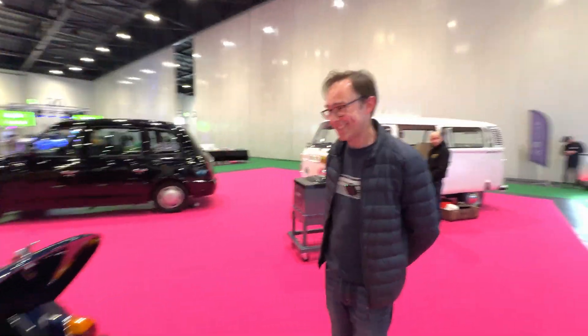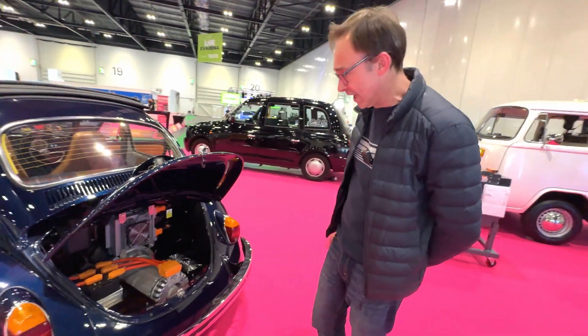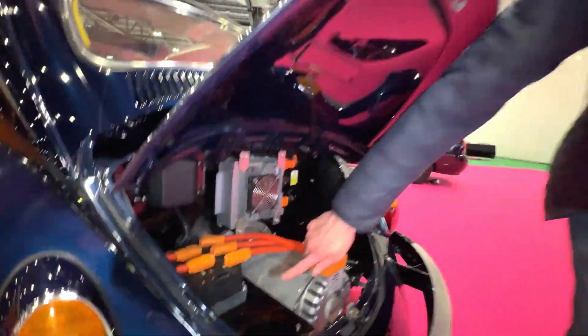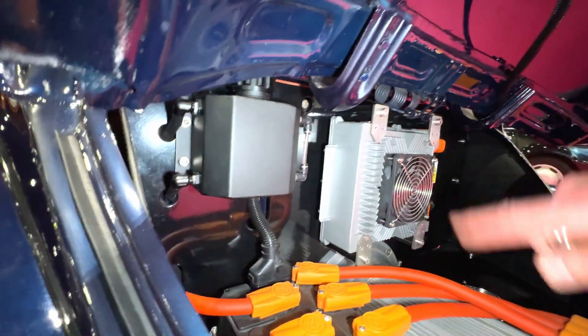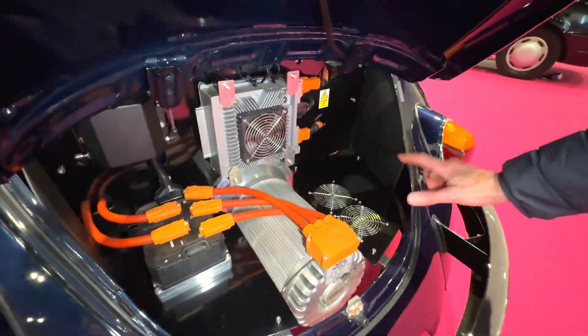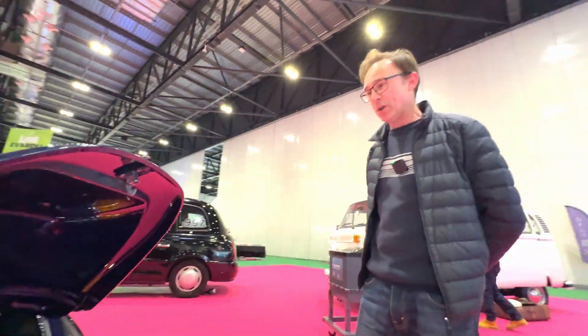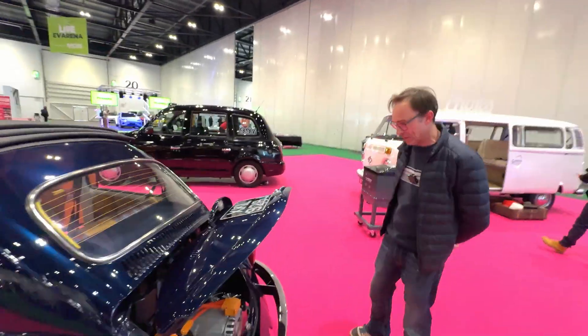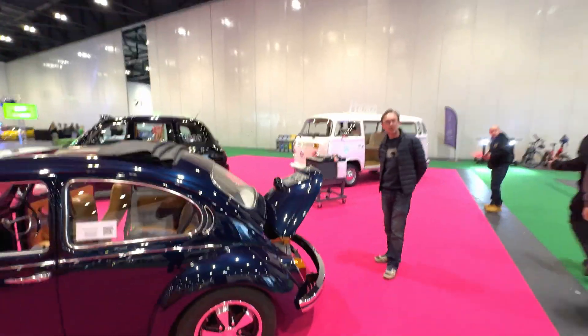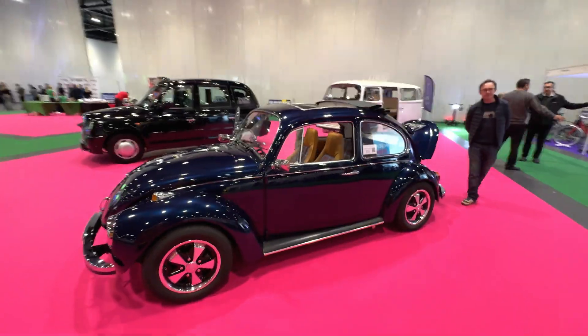One last thing — this is properly air cooled like the original, isn't it? Not quite. It does have liquid cooling for the inverter: there's a tank, water fed down with coolant, a chill plate that feeds down to the radiator, and it runs fans. So it's air-cool-ish. Thank you very much, Calum. Guys, if you liked what you saw today, let us know in the comments, give us a thumbs up, and we'll see you in the next one.